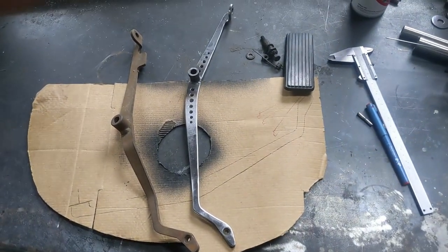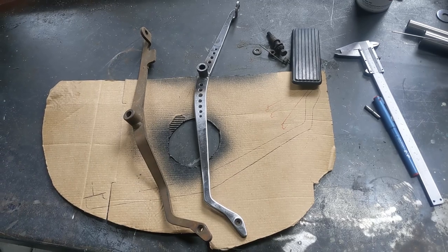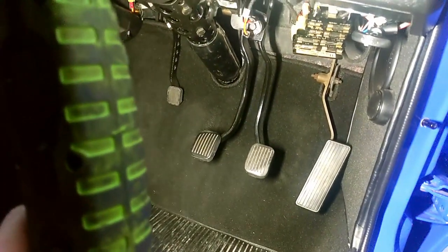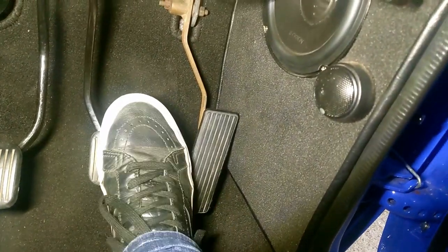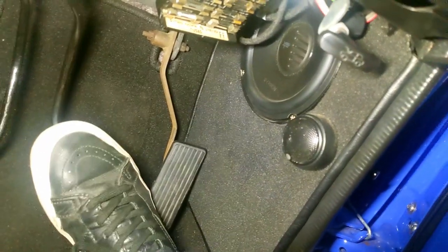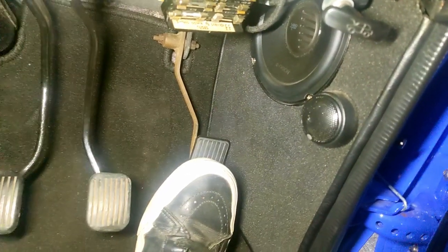It'll be angling in a little bit, and I don't think any of those are bad things — I think they're all good things. That allows you to do nice easy heel-and-toe. You can do this to any Torana and it'll make it a lot better to drive in the hills. I've set my car up with the V8 pedal — it already had a modified one, a rusty-looking one. It's only loosely hooked up, but just to demonstrate: if you look at the way my foot acts with the brake, it's incredibly difficult to interact with that even when you're on the brakes pretty hard — you can barely give it much of a blip at all.